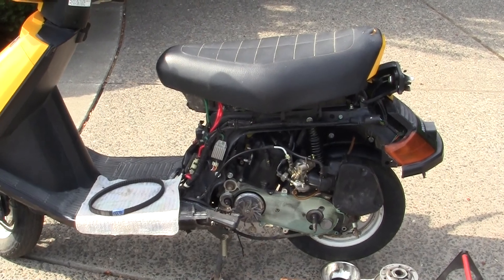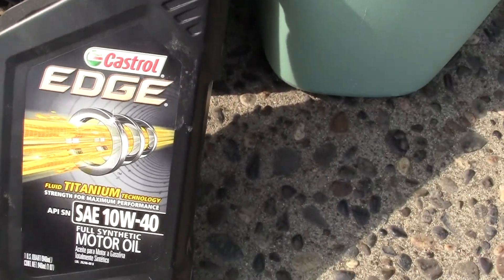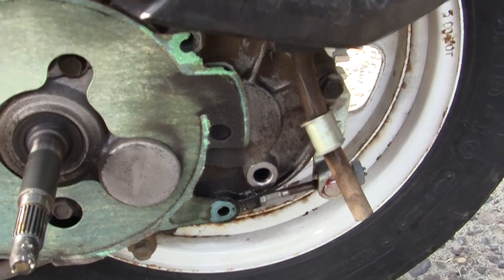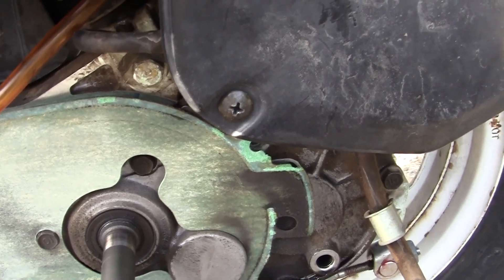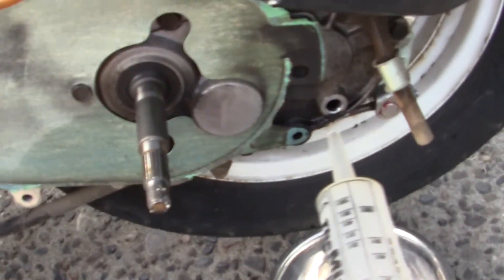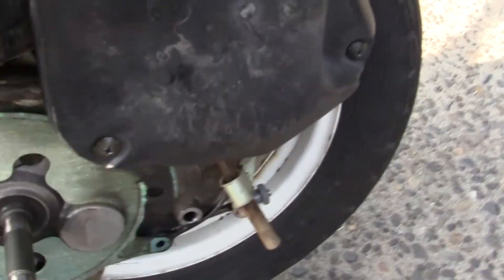The next step is going to be turning the clutch down. Also, this is synthetic motor oil which I'm going to replace in your transmission. Your transmission is this little tiny part right here with the screw hole in it — it holds like a half an ounce. What you do is you empty the old oil out right here. It's got two or three big wheel gears in there and the oil keeps everything lubricated. You empty that out and then I use a little implement here to put in new oil until it starts to run out, then put the screw back on.